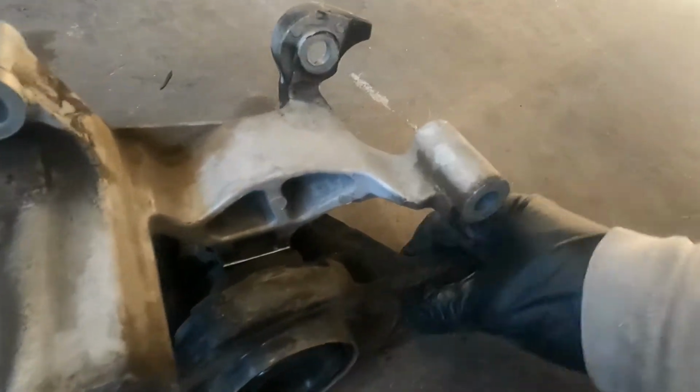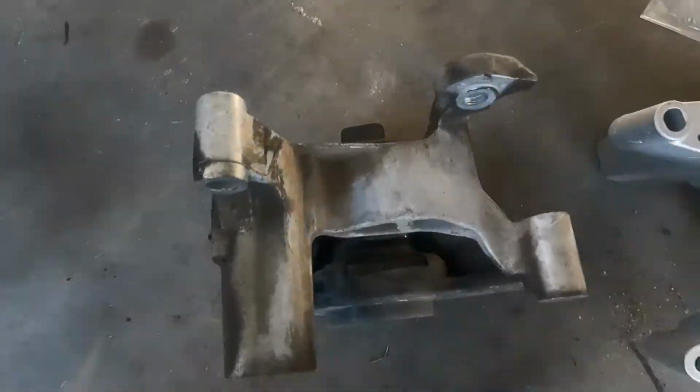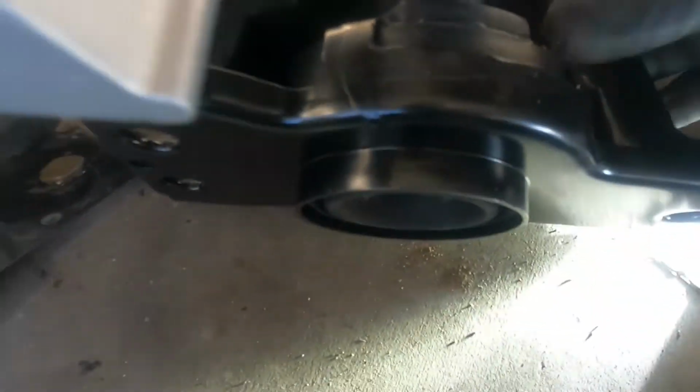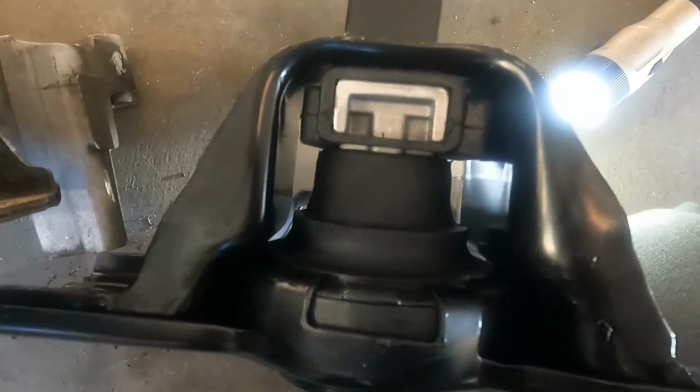Now in the engine mount, sometimes it's kind of hard to see the areas that are broken because of the weight of the engine. But every time you see that part of the mount, you have this thick area. Let me get a light. Touching each other. That means your engine mount is already collapsed. Like you can see here, there is space between. You should always have that space. Otherwise, this area is collapsed already, it's damaged. So if you see this one, that's a big difference, right?